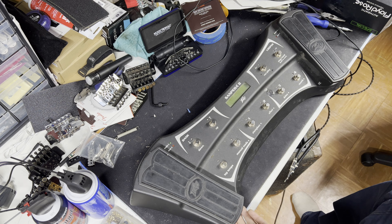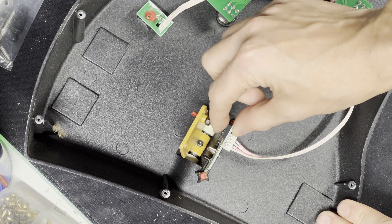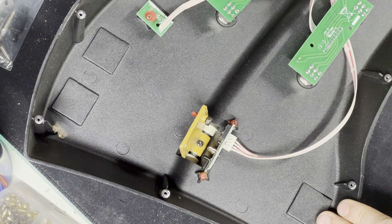What we're going to focus on are these pieces right here and these boards right here. The way this works is from the inside, there's a little button right here. This piece here is attached to the pedal on the other side. So when you press the pedal down — let me lift it so it makes more sense — when you push it down all the way, it presses the button. So if it's not working and you're trying to press it down and it won't press, there are two ways you can address this problem. The first: you'll notice there's a little screw right here. You can simply tighten or loosen this screw. In the case that it's not working, you simply loosen the screw until it's long enough to make contact.